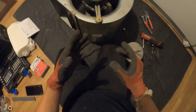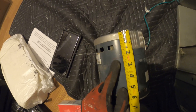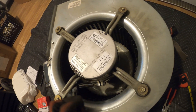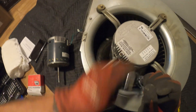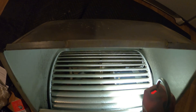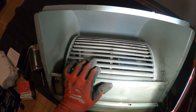You also want to put the motor in a position where you can wire it easily, like the other one. I marked where the bracket sat on the other motor — it's the exact same measurement: two inches and an eighth. This is two inches and an eighth, and I'm simply going to lock this down. Then I'll adjust the fan blade position and lock it down onto the shaft. I can shift it from left to right to find the balance point, then lock down that screw onto the flat portion of the shaft.